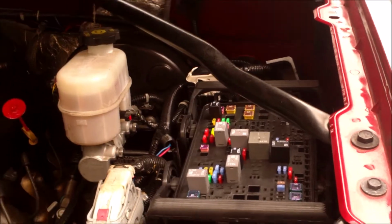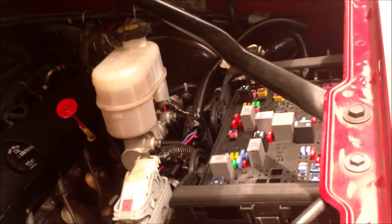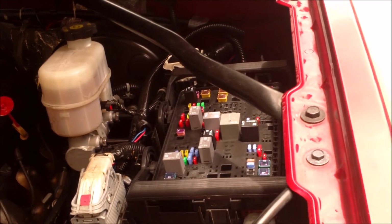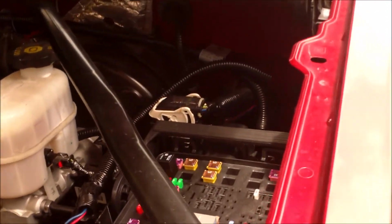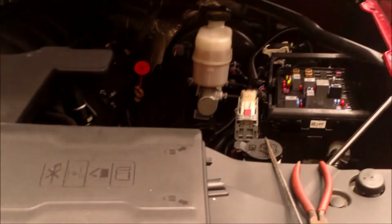And thanks for watching. Okay, in final closing, we replaced this fuse box. I checked the wipers. They're working in every speed now, low speed and high speed. The fault was inside the fuse box, and there was two soldered relays inside that fuse box. Not serviceable. Don't forget to finalize your project by connecting your ground strap over here to your stud. This just pops out of there, by a clamp, I mean two little squeeze buttons there, and then put on your ground clamp over here on your battery, and you're good to go. Mine worked fine, so we put our cover on, and away we go.